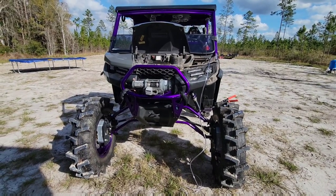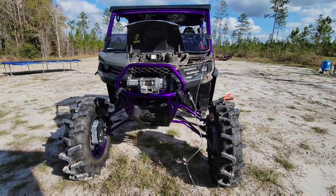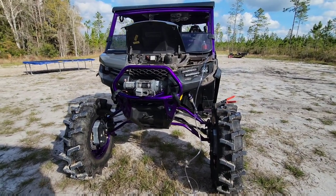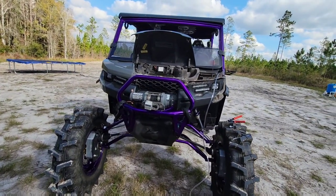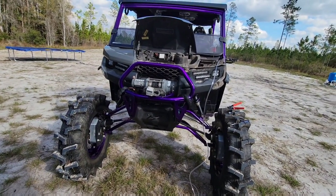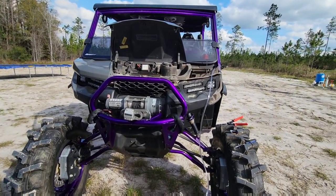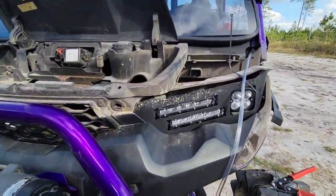For those of you that don't know, I've had a lot of time invested in doing Hondas, and that's caused me to ride deep — a lot of Florida and Georgia has a lot of water. I've really learned about running vent lines and I want to run them clean on this thing. On the front differential, the last couple rides where I've had it deep up to the hood, I've noticed a little bit of water in my diff. I checked my axle seals and they actually look okay, but the one time I went deep I think I got water in my vent line.